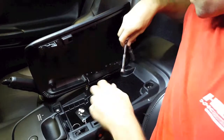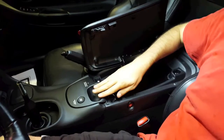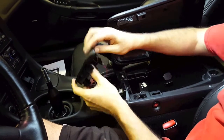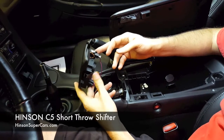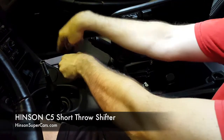We'll set the hardware to the side. With the rear hex nuts out of the way — those are 10 millimeter, using a quarter drive — now we're going to remove this switch panel up front. This just pries up. You can use a flathead screwdriver, or it's held in by two metal clips; it's very easy to remove. There's no reason to unplug these two things, you can leave them plugged in. We're just going to hang this to the side for now. Be careful not to scratch anything.